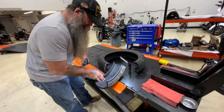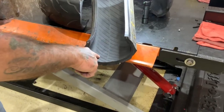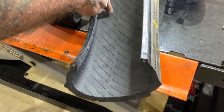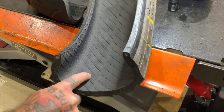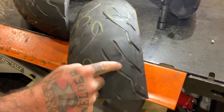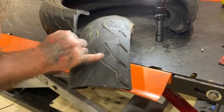You can see really well here what Larry was talking about. If we zoom in here, we can see these different dark places in the tire — a different coloration in the rubber. What that is, is where it's heating up. If I roll over right there, you'll see where that's getting low. So that discoloration is directly underneath the low spot — that shows how hot that's getting and it's starting to wear.